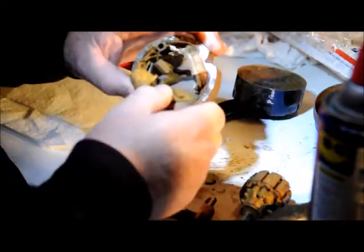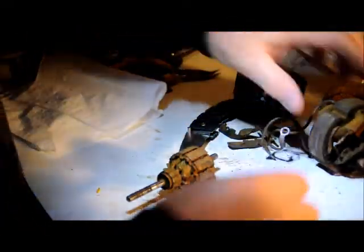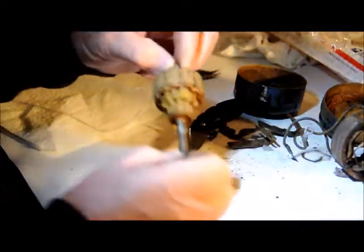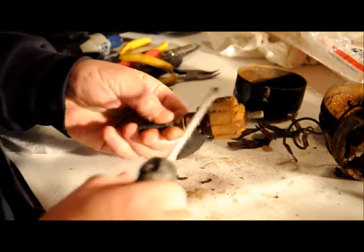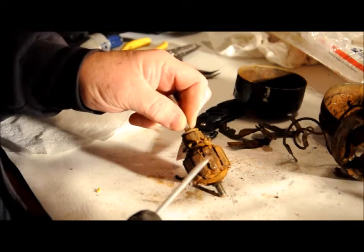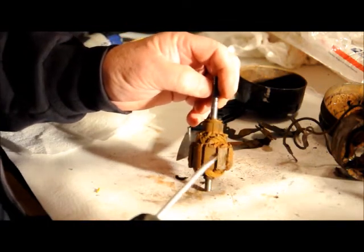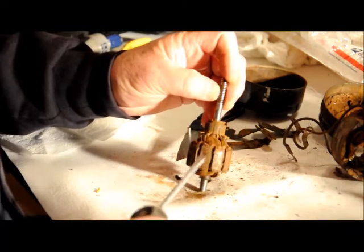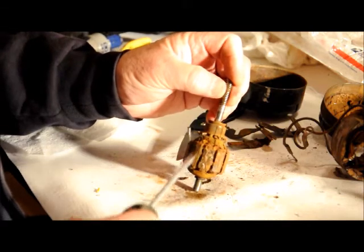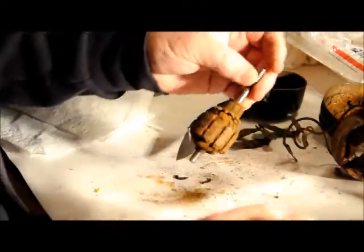This is our magnet. Let's get our brushes here. First thing we have to do before we go any further - because if this test fails then the whole thing is a moot point - we have to see if this piece is any good. These wires wrapped around here create the electrical field. If any of the micro-thin coating on these wires is broken, it will ground itself out and there will be no electrical field. This can be cleaned, that's no problem - these are just metal plates that create the field. But if we don't have intact wiring for these fields, then this is never ever going to run.